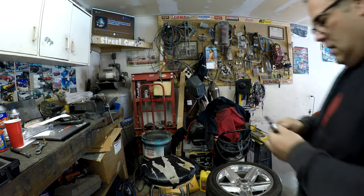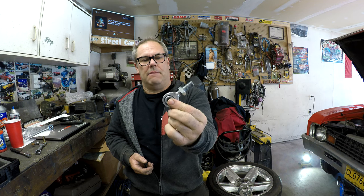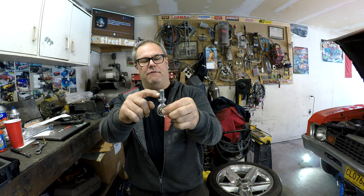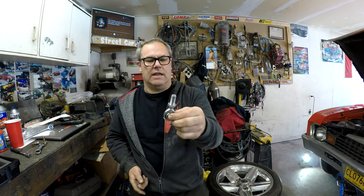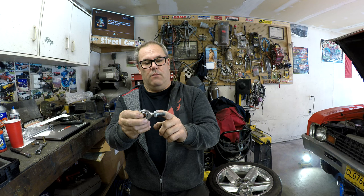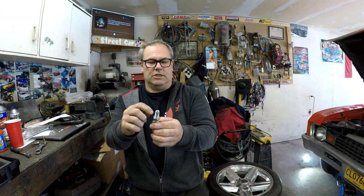I'm basically gonna turn the rod end out to give it more camber out to get it to zero. If you're planning on buying these TRZ control arms and want to know - you could check them before you put them in the car, like I should have done. The rod ends are this long, so you obviously can't go out more than half because then you don't have a lot of threads contacting. I took it out just to see - I'll go out three threads or something and then see how that is.